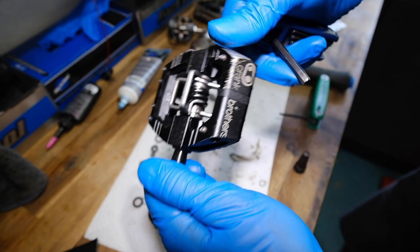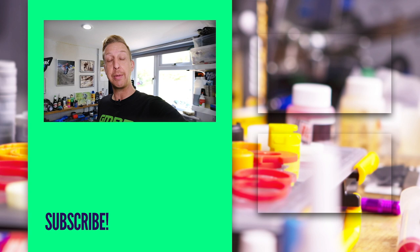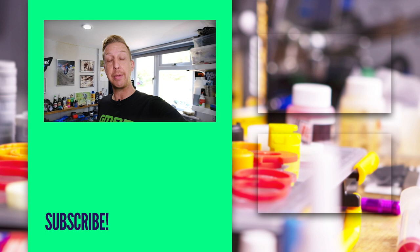So I've done three pedals there, and I'll get the other ones done behind the scenes. That was the Dodd's-eye view on overhauling my pedals and a couple of others just for good measure. Don't forget — the main difference between the two is that some pedals have an axle that spins within the bearings with the bearings mounted in the pedals, like the Crank Brothers ones. It's the other way around for those Shimanos, and a little bit more fiddly if you want to do a full service. If you want to see me do a full breakdown on a pair of Shimano pedals with the macro lens, let me know. If you want to see any more Dodd's-eye view videos, let me know what you'd like to see.